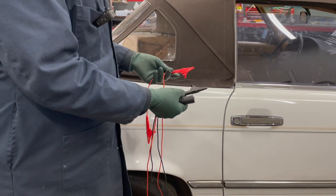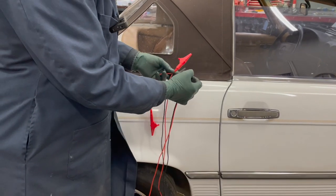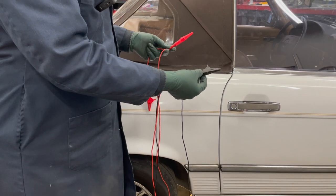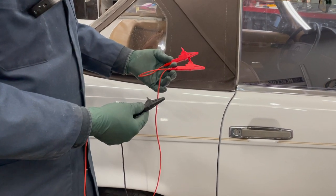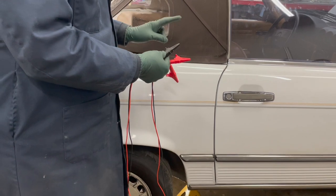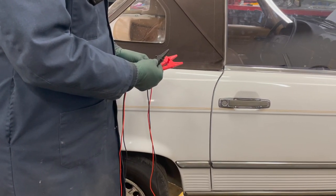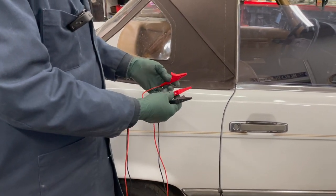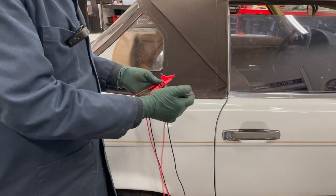Let me show you the wiring setup I made for the 560 SL. This would apply to any of the twin pump KE Jetronic systems in the mid-80s up to the early 1990s. We have one long wire running through a switch so I can turn the pumps on and off, and of course we've got alligator clips. This was originally designed to run one pump like in the K-Jet systems in the 380 SL, so I had to add another alligator clip on this end to power both pumps. I'm going to go underneath the car and disconnect the wires — I don't want any 12-volt feedback back to the original wiring. I'll disconnect the two power leads to the pumps. Brown is ground, so it's going to fool you because the black and red one is actually the power lead. I'll take those off, hook this to the positive of the battery, go under and hook these two alligator clips to the two positive inputs on the two fuel pumps, then hit the switch and the pumps will run.